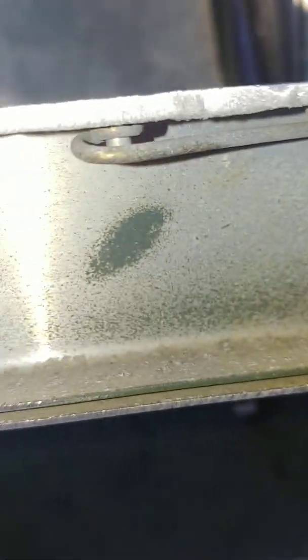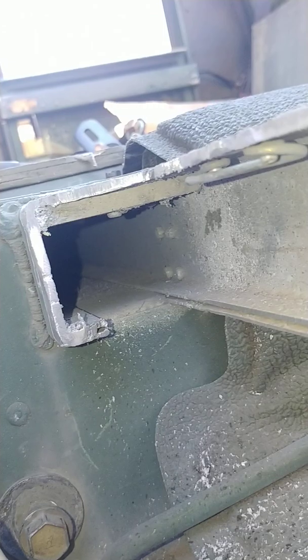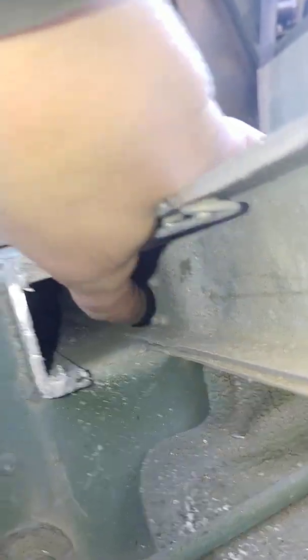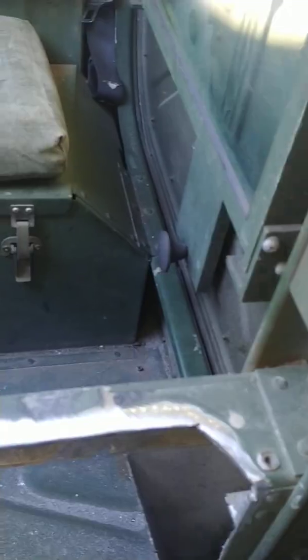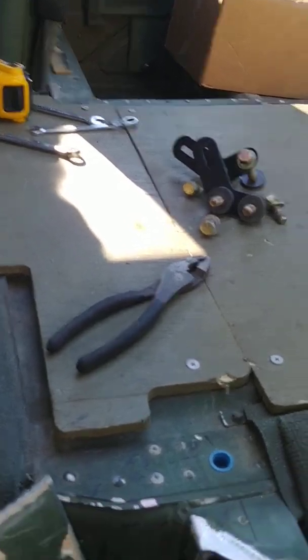Something I did not know and I don't think I've seen mentioned: this horizontal B-Pillar bar actually looks like it goes clean through to the passenger side. It's riveted here — the body's riveted to it — and it's welded around here, and you've got a reinforcement right here. I was under the assumption that this piece only went from the outside pillar to the trans hump, but it does not. It goes clean through to that side — one long piece by the looks of it.